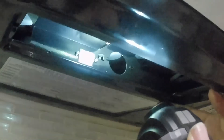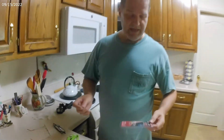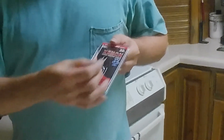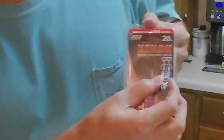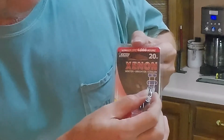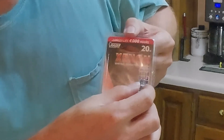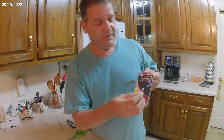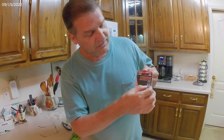That burned out. Remove the cover, pull the light out. When you pull that light out and go to the store to buy it, you buy it based off the prongs that you have and the size that you need to replace. The prongs fit this width — these two holes here — and this length where the lines come from to the base. You can take your light with you and check that it's the right length and the right width.